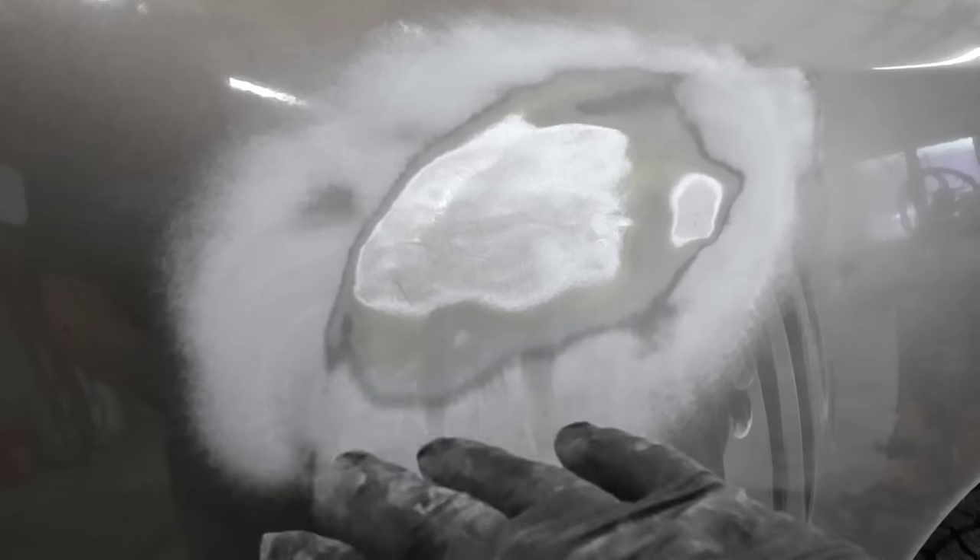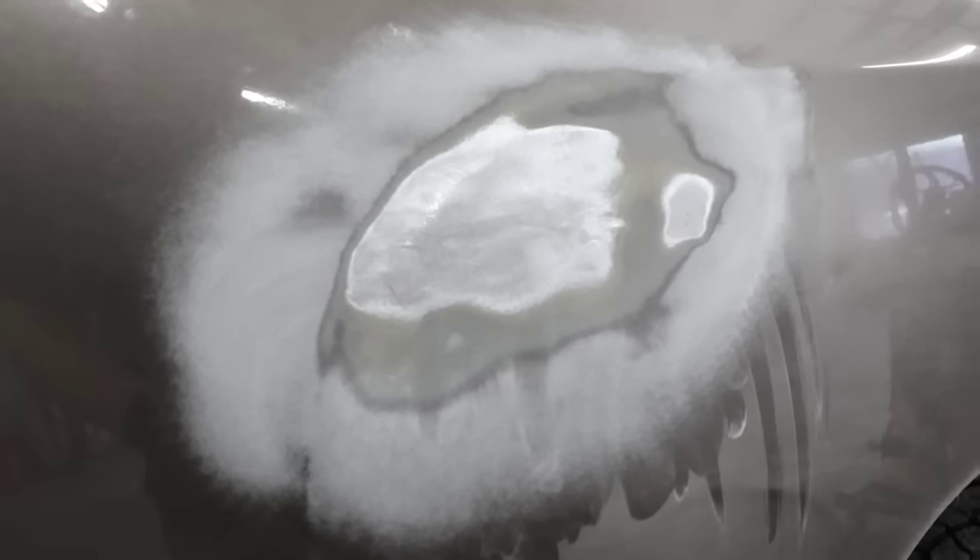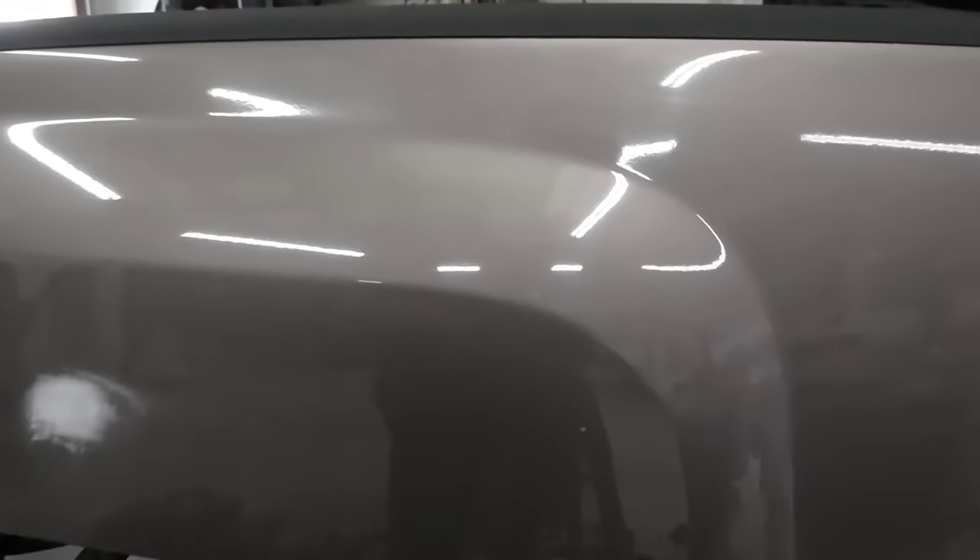You can see the layers - basically there's a primer, and then there's a paint and a clear coat. You can see those layers here - that's what feather edging is. We've got a smooth transition from the metal to the original paint. I went around the edge just a little bit larger so we can put our filler over properly sanded paint. 80 grit is the proper way to sand paint if you're going to apply filler over it. Not all fillers can be applied over properly sanded paint - you want to check the technical data sheet on the filler you're using.